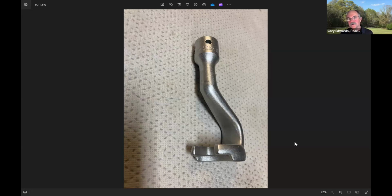And for this car's valve adjustment, they were all pretty far off at first. They were very, very stiff. I was using a long breaker bar with an extension on it just to have enough strength to move them. And I think they're really kind of intended to be that way so they don't unintentionally move. And of course, you have to turn the engine over a bunch of times when you're doing this. So the best way to do that is to remove the fan, remove the fan shroud, and I remove the upper radiator hose as well, just so you can get access to the nut on the front of the engine to use to turn the engine over.